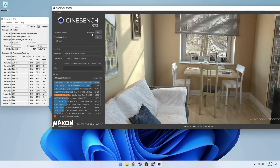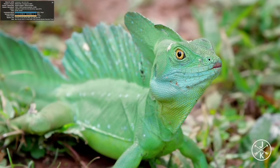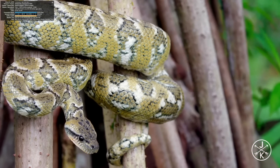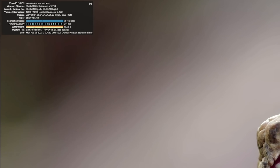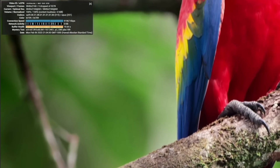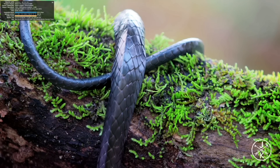At the end of the benchmark it scored just under 11,000 on Cinebench. Those numbers are pretty good, but I always prefer testing real-world use cases. For 4K video playback — a good indicator for a media server — running through multiple thousands of frames we only dropped three altogether. Those are the lowest dropped frame numbers I've ever seen for a mini PC without a dedicated graphics card, so for media server or high-resolution video playback this will do it no problem.